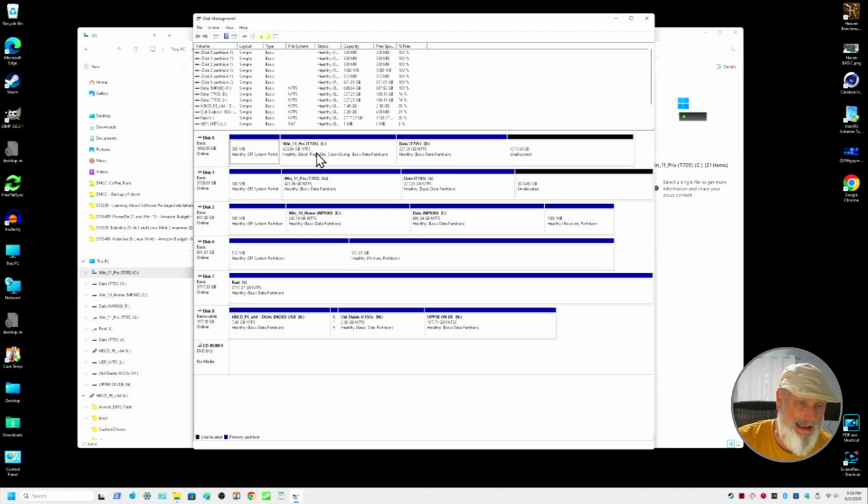Look at our unallocated. Because we have 300, 111, 705, 705, but look at our unallocated portion. See, we only have about 1.2 gigabytes instead of the 3 gigabytes that we have. I guess it'd be terabytes at this stage, wouldn't it? See, 1.2 terabytes and then 3 terabytes. So this is definitely the bigger one. And so we did start off the right drive.